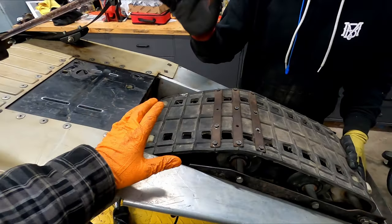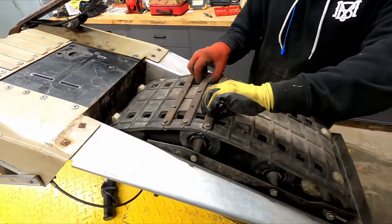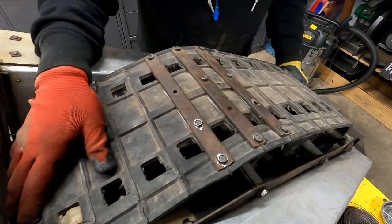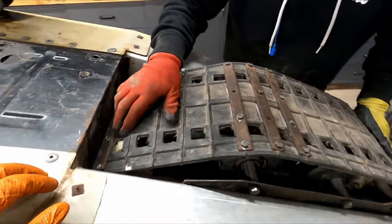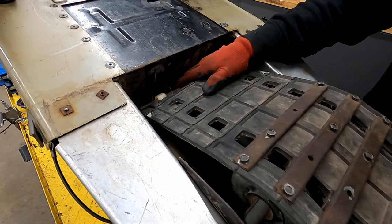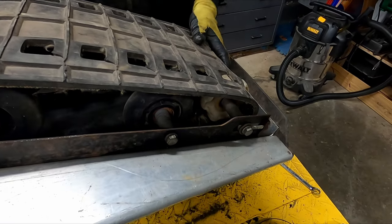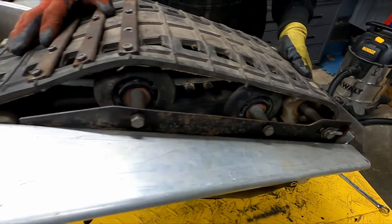So what's the problem, Doc? Bad news, test number one did not work. Yeah. So these metal bars, it looks like it's getting in the way and it's binding the track too much, that these cogs aren't getting in the holes they're supposed to. So when they're not touching the bar, it seems to roll fine, but when it goes through a bar, then the track just jams. Yeah, you can see all the resistance right now, like it doesn't even want to turn.